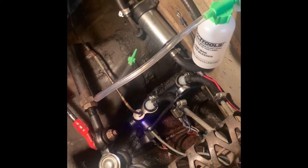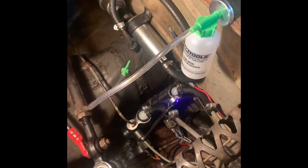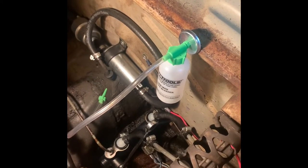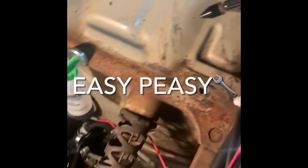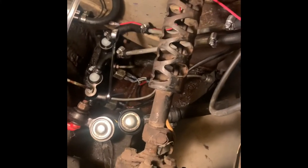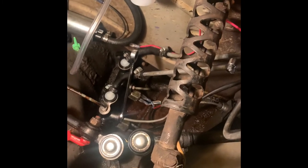Each wheel you do, start with an empty bottle so you know how much brake fluid you pushed through — when that bottle is halfway full, there's no air inside the brake lines. Start at your brake cylinder, loosen the fittings, bleed brake fluid out with a rag underneath, then tighten them up. Go to the first wheel, second wheel, rear wheel, other rear wheel — tighten up the bleed fittings. Once you do all four wheels, you're done. No pumping brakes — it's a clean, easy, power-pressurized brake fluid change.